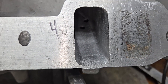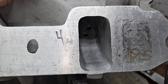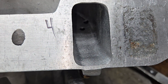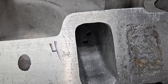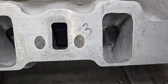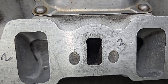You can't just have it like a bell mouth - that isn't going to work. The problem with these is the runners are so deep and long you can't get to the entire thing. The roof of this port is really thin - they all are. I had to use the sonic to make sure I didn't go too thin or make it fail while in use. Our short straight runners needed a ton of work due to that extra area, which made them flow even better, so our ratio of worst to best flowing port is kind of out the window.